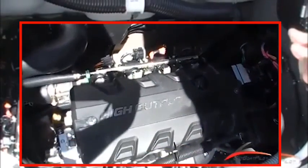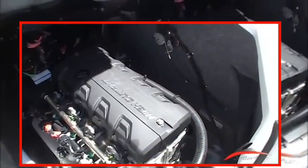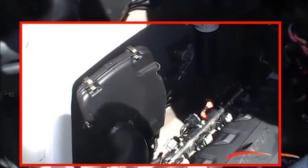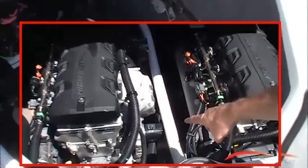In this compartment you have a panel right here that will come off. Once you pull that panel off, you can replace your spark plugs very easily on your own. There's a massive air filter over to the left here that you can also replace on your own. Oil changes are relatively simple now because your oil filters are right up top — you'll notice they're to the right.